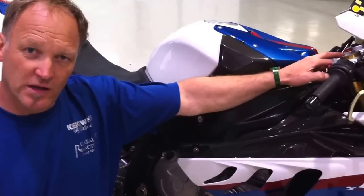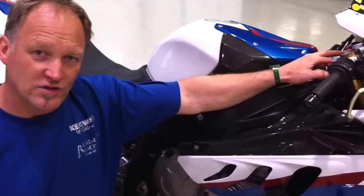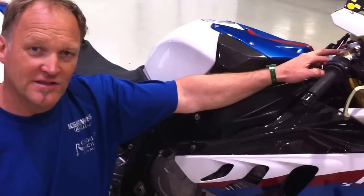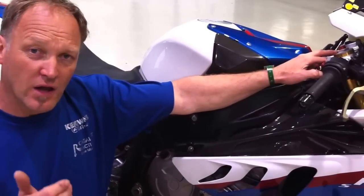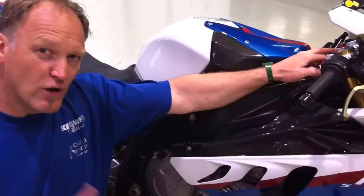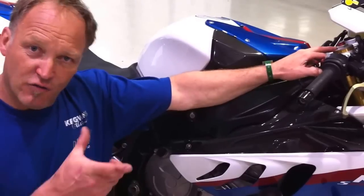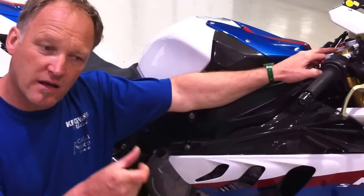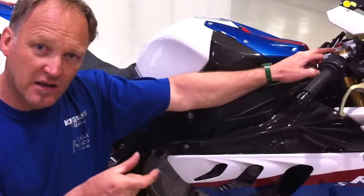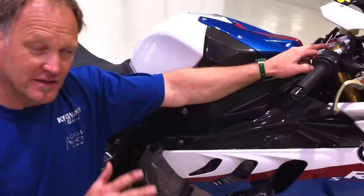So we had to soften them up a little bit, give them more flow, and the worst thing of all was that neither of them had any seal grease in them at all, so there was a ton of stiction in the front end. So braking gave up a lot of chatter. And from riding Abdelrahman's bike the whole of the afternoon here, if you brake and maintain pressure, there's no problem. If you brake, let go, and go for a second grab on the brakes, it will chatter like crazy.